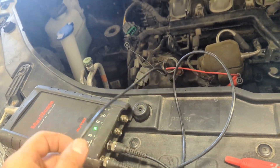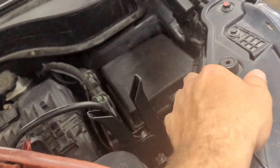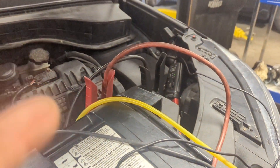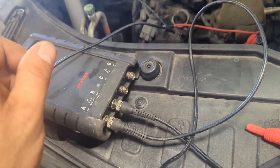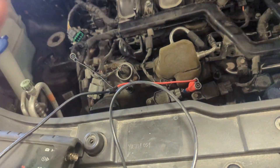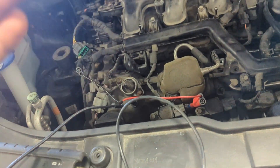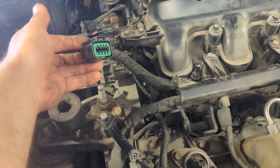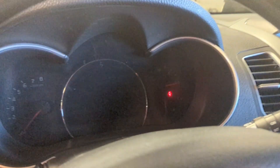After that we are gonna hook up an amp clamp to my negative battery cable — you can go positive or negative, I'm going negative on this one because there was only one wire on my negative so it makes perfect sense. After that we're gonna hook up channel B to ignition coil number two. What this is gonna do is allow me to sync each cylinder, so if I have low compression on one cylinder I'll actually be able to see that low compression. From there all that's left is to disable fuel or ignition — on this one I disabled fuel just by pulling the connector. Now we're gonna crank the car over, get some data, and try to decipher what that data is telling us.